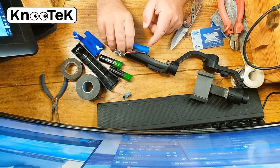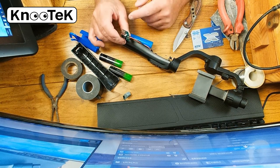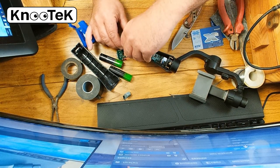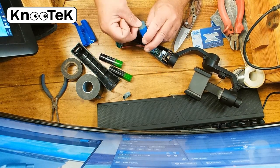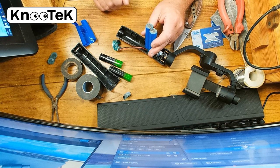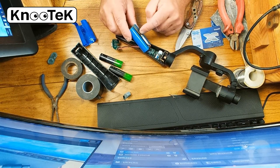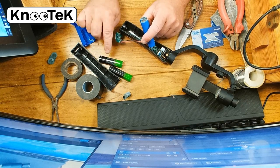I think you can actually plug your phone into this USB port, so you could potentially charge your phone off the device - though that's a bit of a silly thing to do. The paper needs to come off the battery ends. As you can see these are flat tops and they're wired in parallel, not series. So the combined capacity of the original battery is 2000 milliamp hours, and these new ones are almost five times more.